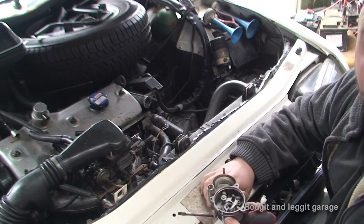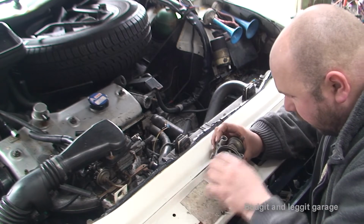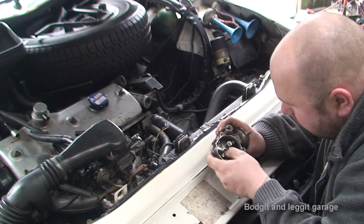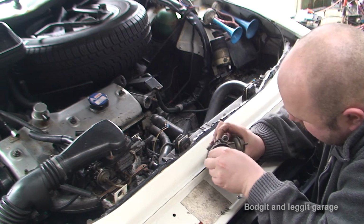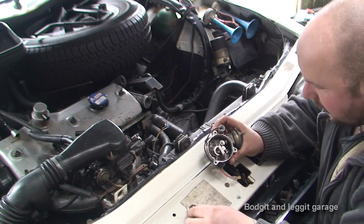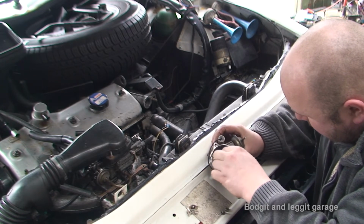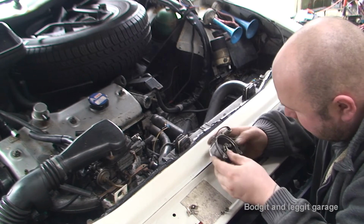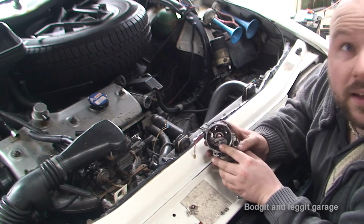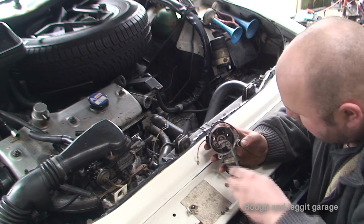So that wasn't even holding on, that second bolt. But lucky enough, we don't need that anymore, so it's not going to cause us a problem. I just need to get this plate out. So that's the actual striker plate. Now we need to get the points out of the way. There's a little clip here, which hopefully I can pull out. You can just see, again, I don't know if it's coming through, just a little clip. You just pull out the clip.